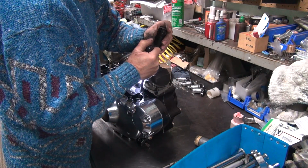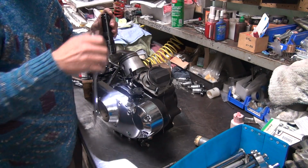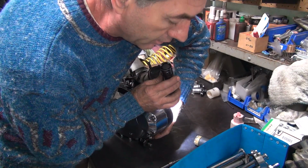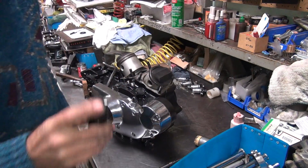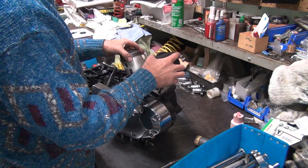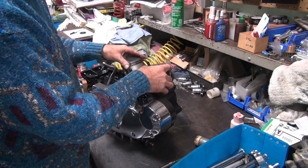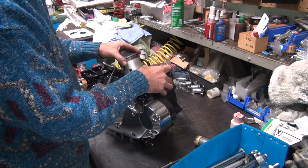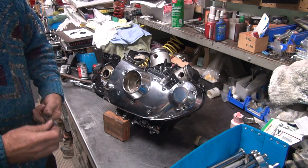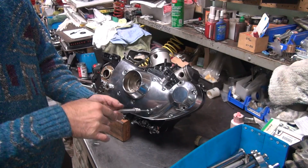Yeah, I can slide it, but it's tight. It's definitely in the front cylinder. These 2 gears are a little bit snug, but they do move. The idler gear, no way. So it's binding up, most likely the idler gear is what the problem is again. There's something in that one spot. It's right there. Something is causing it to bind up a little bit. Not sure what it is.